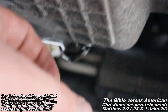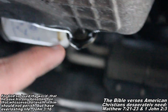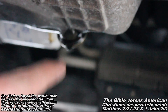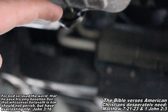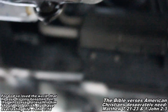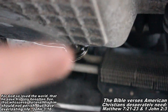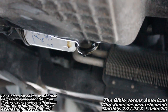If it does that to you where you loosen it up and pull it out and it doesn't come out, then there's a nut on the end of it. This is how mine was. I was a little frantic when it wasn't screwing back in. But then I realized I pulled away and then righty-tightened it — I held that nut up against the oil pan by pulling out and twisting right. So I was able to tighten the nut back up, and once it gets up close to the oil pan you'll be able to tighten it again with a pair of pliers. I don't know if it's like this on all PT Cruisers because I saw another video and it was just a bolt — maybe this was some kind of fix along the way. Just let me know if you have the wing nut oil drain plug.